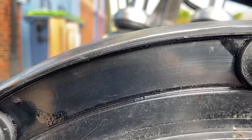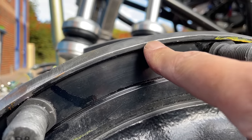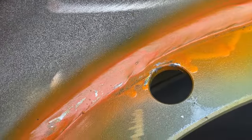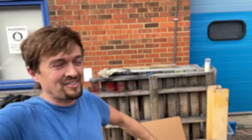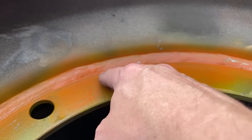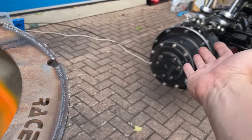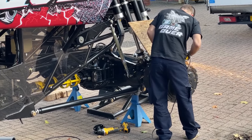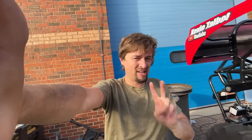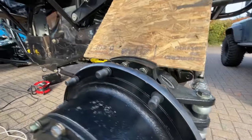After more hours on this, it's about as much as we can take off — there'll be nothing left for the wheel to sit on. We've chamfered all the way back to that edge, painted it again, and it's still touching in a few places. I do not understand why this is so difficult. Monster Jam have to grind theirs down as well — every team just has to spend hours and hours grinding. Now I've got to take a little bit off this weld too, because if it sits on the weld and you bolt it up you can end up cracking the hub. Day number three of grinding and we've finally got all the hubs done.